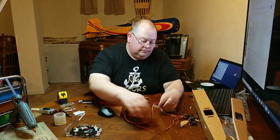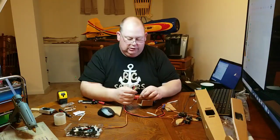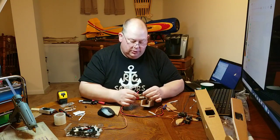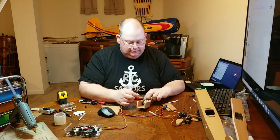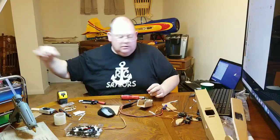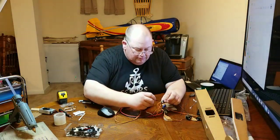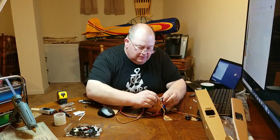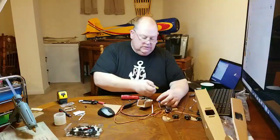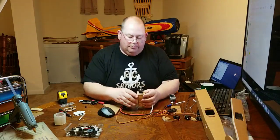And then, of course, here's the ESC that I'm going to use. And the bullets that were on the new motor matched up with this. Oh, I unplugged that. So we're supposed to, after we get this connected, turn on transmitter, plug this back in. Like that. And I got a battery right here. Transmitter's on, throttle's down. No prop. Never want the prop on there.